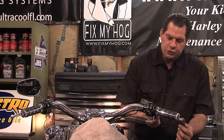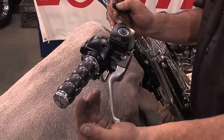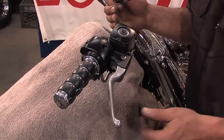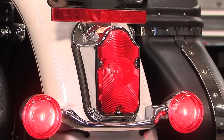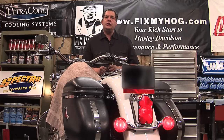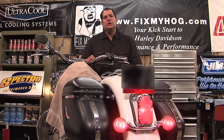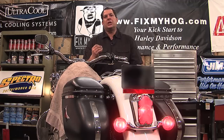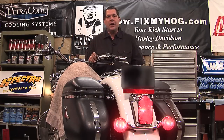Last thing I'll do is remove the stopper and allow the lever to return all the way out. At this point, if you turn on your ignition switch, the brake light should be out. The brake light should operate normally — it should be on when the lever is depressed, which means the switch is allowed to move outward and complete the circuit, illuminating the brake light.